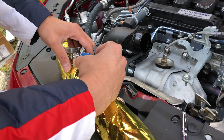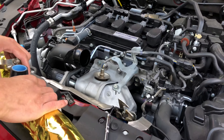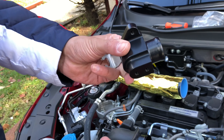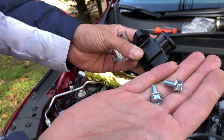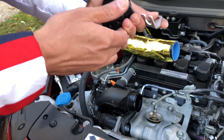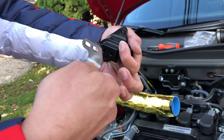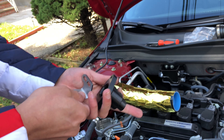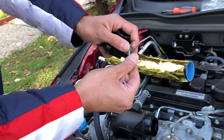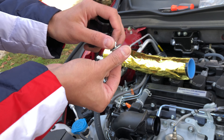We got three small clamps — the small one is gonna go right there. Don't tighten all the way up just yet. There are two clamps: one is longer, one is shorter. In the package there are also two bolts that come with it. The two bolts are pretty much gonna go in this section here to hang on to this side, and the factory bolt that we removed we're gonna place it here to stabilize it.